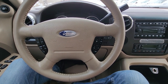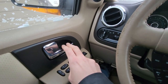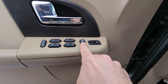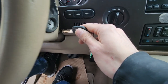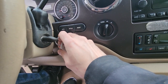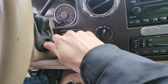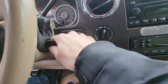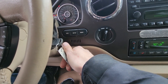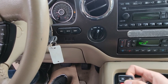To do that, first sit in the vehicle and close all the doors, then open the driver door all the way and press the unlock button once. Then insert the key into the ignition lock and toggle it between off and run eight times: one, two, three, four, five, six, seven, eight. After the eighth time you will hear the vehicle lock and unlock automatically.